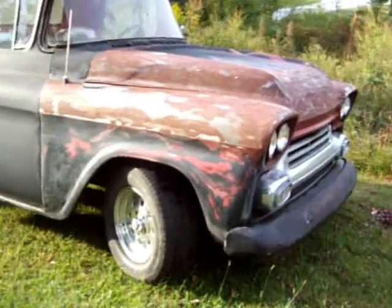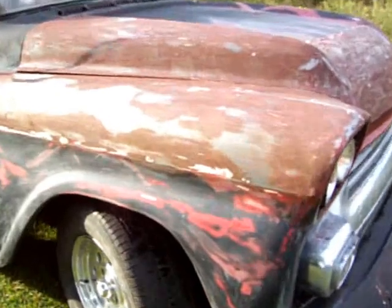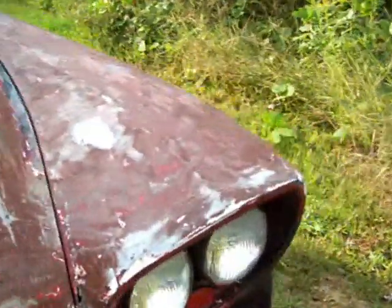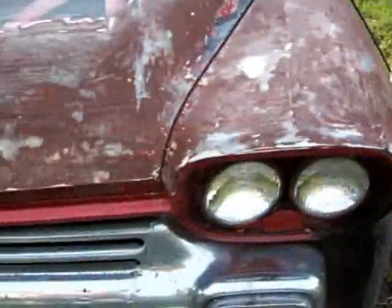I got the truck out here. I came out and washed all that old stripper off — I'm down to the sealer on it. So all I gotta do is take the DA sander and go over this, and that won't take nothing to knock that off and get down to the metal.